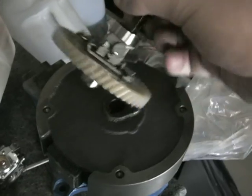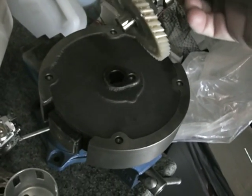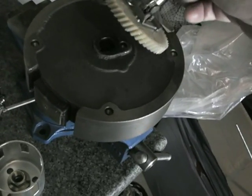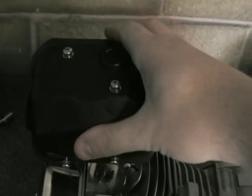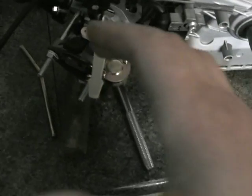That's a standard cam I've taken out — nylon gear. There's a high-lift cam coming as part of the kit, as well as an aluminium flywheel, because that weighs nearly three kilos, so there'll be a bit of weight saving there. There'll also be a new connecting rod, a new exhaust instead of this boring old muffler, and a nice big chunky foam air filter.